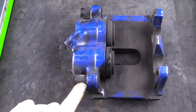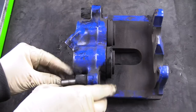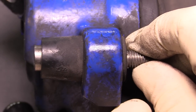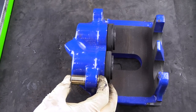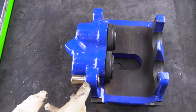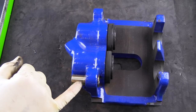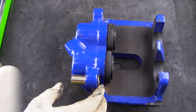What we're doing with this kit is replacing these rubber bushing pieces with metal ones. If I were to slide this caliper in, you can see there's a pretty good amount of movement. We'll remove the rubber ones and replace them, and that'll eliminate any play in this part of the caliper. What also happens over time with axle boots slinging grease everywhere is the rubber piece will get saturated in grease — it'll expand and get even softer.